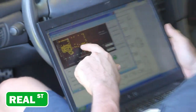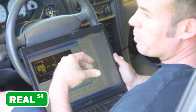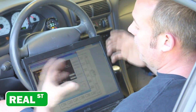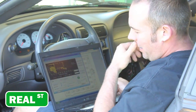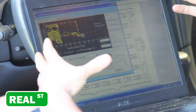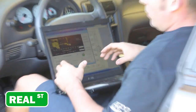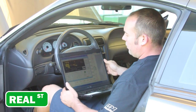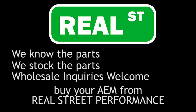As you can see, once the AFR was above your plotted line, it shut the engine off. I have a pretty long time set on the alarm reset, but you can make it shorter if you just want it to flip. This is a failsafe condition — the driver now knows it's time to check out what's wrong with the car before continuing with any wide-open throttle. I've wired this in to kill power to the ECU when triggered, and there's an alarm test so you can confirm the failsafe circuit functions properly without having to test it on the road. We've got some experience with the product — it's a stocking item here at Real Street. If you have any questions, please message us. We'll see you next time.